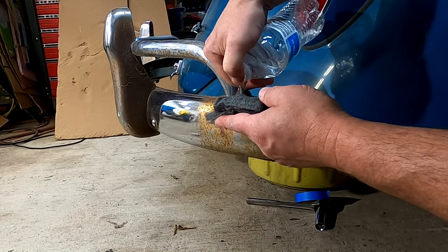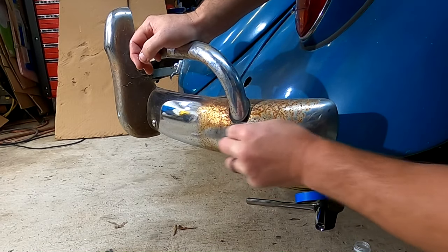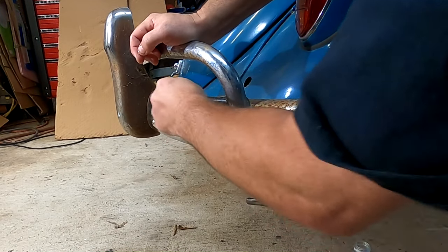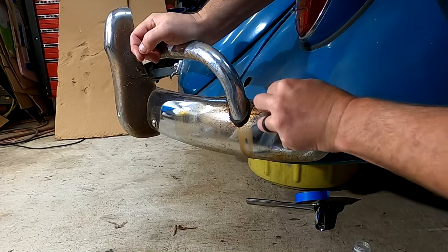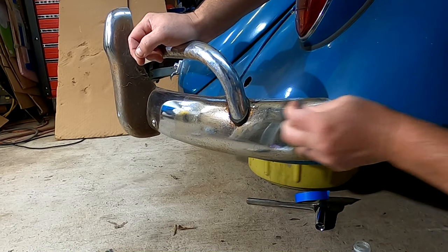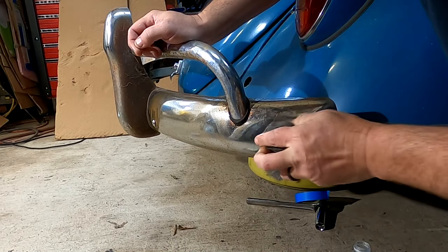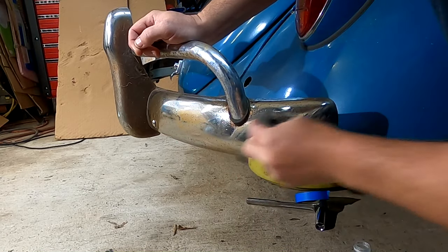Put a little bit more water on here. That's crazy — I never thought it would work this easy. I had a feeling it would work, but not this fast. I mean, I can have a set of pretty decent looking bumpers for two bucks and whatever the Mother's and stuff costs — under ten dollars, you're going to have a set of decent looking bumpers again instead of these rotten things. It'll probably come back after a while, but if you keep it waxed up it'll keep its shine. This is a great solution instead of having them re-chromed on the cheap. Eventually we will — I'm going to restore this car, repaint it back to factory color, and then get these bumpers re-chromed.